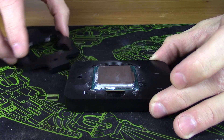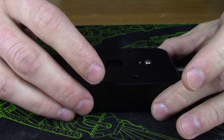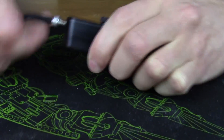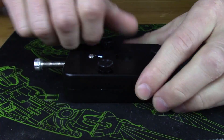Then we break out the Rocket 88 de-lid kit, which you can purchase on their website — I'll leave a link in the description below. You place the CPU into the crevice with the arrow matching up, place the lid on top, put the three included screws in and hand-tighten them, then use the provided allen wrench to crank down the outer screw. You'll hear a mild to loud pop, then unscrew it and you'll have a successfully de-lidded CPU. Be very careful not to scratch the PCB.